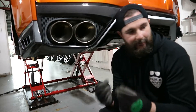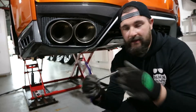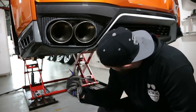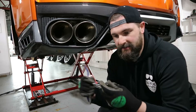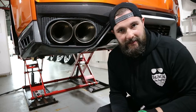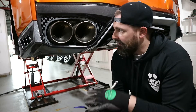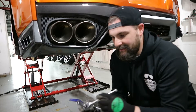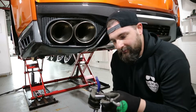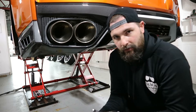You can do this with very basic tools. What you're going to need is a trim removal tool. You're going to need a socket — 14mm. For some reason there was a different sized bolt on one of these, so just a small selection of sockets. Even the most basic tool kit has a 13mm. This is used for removing the actual bolt on the tailpipes. It's best to either have an extender or a long socket on the end of it — it just makes things a bit easier to get to.